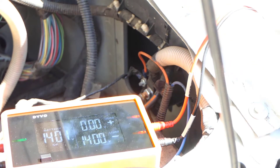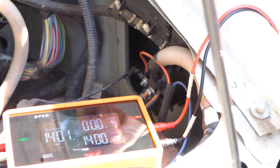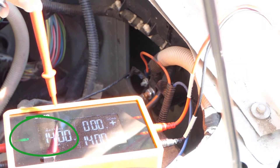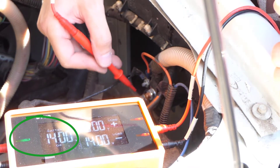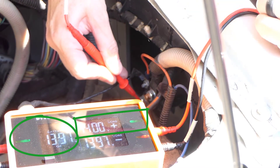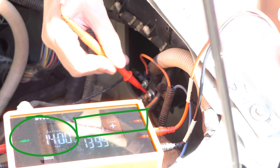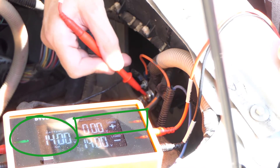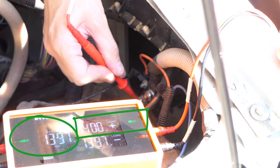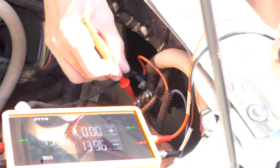I apologize because we're right in the direct sun, so I know it's very difficult to see. We're at 14 volts for our starting battery. Let's take a look over here in voltage available mode to see where we get our 14. There's 14 volts on that terminal right there, and 0.25 volts on this terminal right here. So very clearly we know that these two are not being bridged. This clearly goes back to the starting battery, and we can see how close that is to the battery — I can look at voltage loss and we see we have no voltage loss. This is clearly the starting battery.